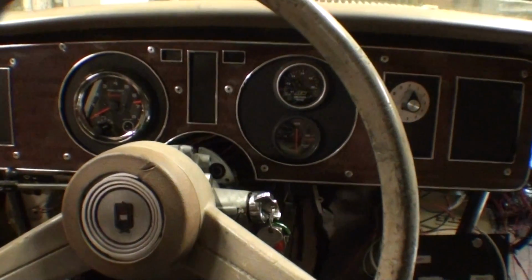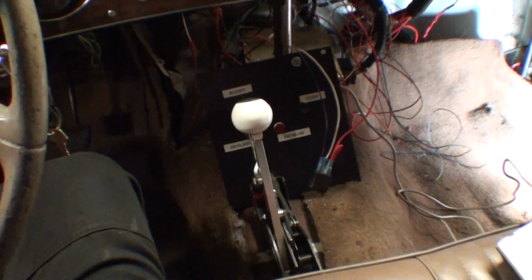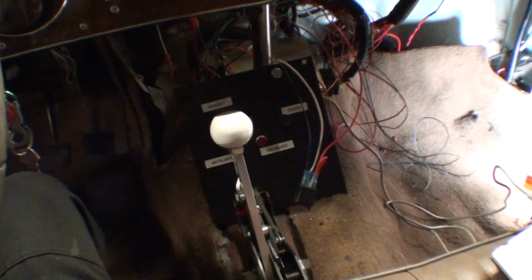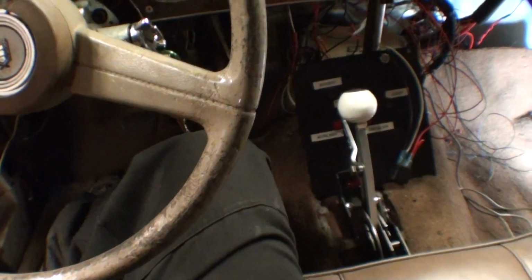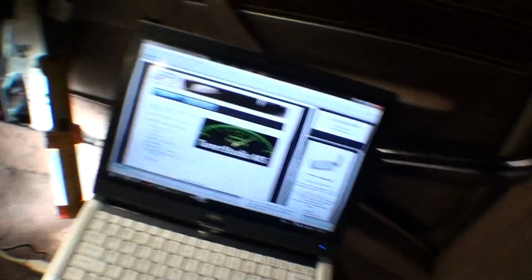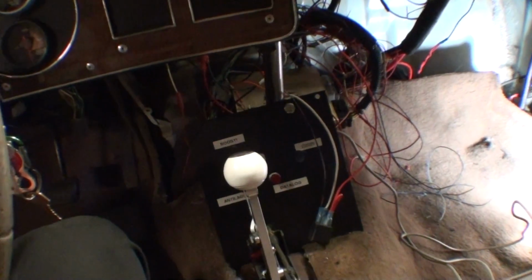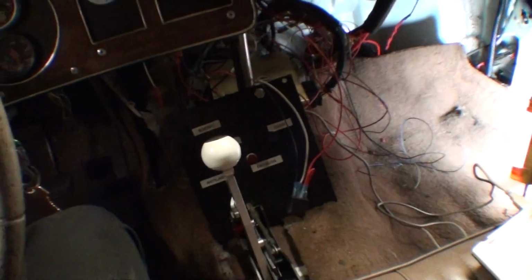Alright, this is the post update: how to wire a trans brake/anti-lag/turbo staging button/bump box/awesome turbo car shuffle into the second staging beam. And how that's done is the MS3 can actually directly control your trans brake. It actually fires your trans brake. And once you get up to your second bulb, here's what happens.